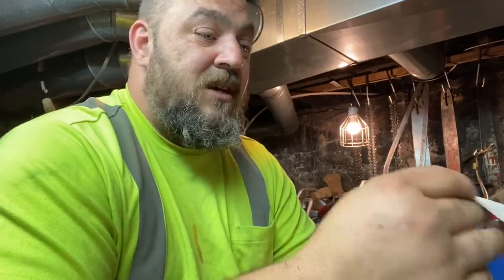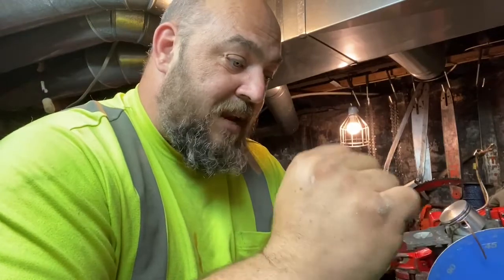So at 103 degrees, just from experience, it's probably in the neighborhood of 8,000 RPM is where it's going to want to produce most of its power. So that's the way I built the saw, to produce its power around 8,000 RPM, with the transfers and everything. If I wanted that more, then I would have to do an adjustment to the squish, because 8,000 RPM without the base gasket, I'd be at about 57 thousandths. That's fine for 8,000 RPM. But as I want to try to raise RPM, I also need to take care of some squish or raise compression.